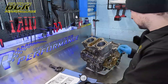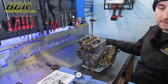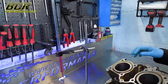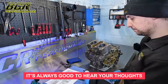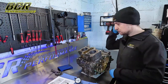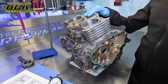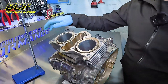The next step after this is to get everything blasted and cleaned, then we'll bring it back in, skim the deck, port the cylinder head, cut all the valve seats, skim the cylinder head, and then we'll show how to calculate compression ratio with the burette — measure the combustion chamber. The next video's going to be the most interesting because we'll be on the milling machine showing how to cut all the seats, how to set it up and get it perfectly flat to be machined. We'll show one cut — obviously we're not going to reveal exactly how much comes off, that's the secret.